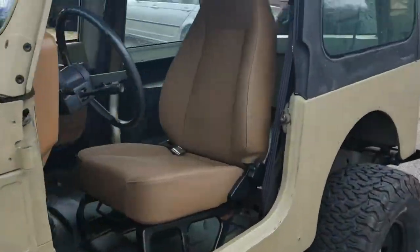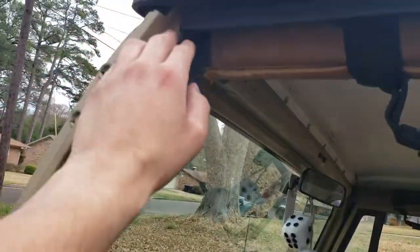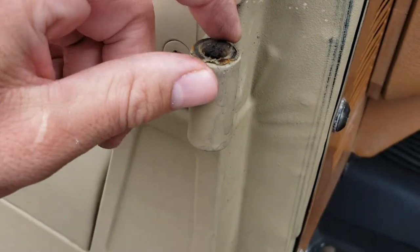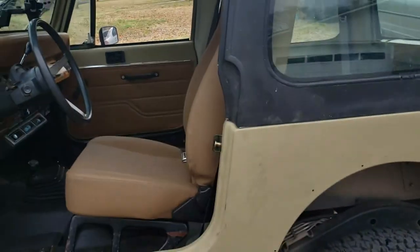The passenger side door — I mean it isn't perfect but it's about as close as it's gonna get. It's flush and everything. The driver's side door on the other hand is so bad I just took it off because it's rattling anyway. It's always too low no matter what. I think this bushing is shot — I ordered extra ones so I might just need to replace the bushing and try again, because it is not flushing up with this at all.